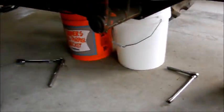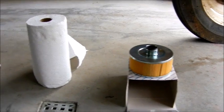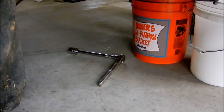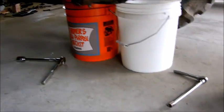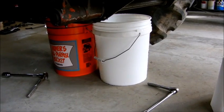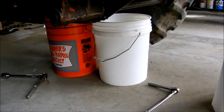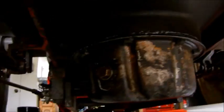You're gonna need a filter — about 20 to 25 bucks on eBay, I'm an eBay shopper. A 14 millimeter with extension and a 28 millimeter socket. You don't have to have that long of an extension but it makes it easier. Also two 5-gallon buckets because this does hold six gallons — 24 quarts. I'll put three gallons in each to make it easier to carry and less likely to spill.